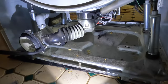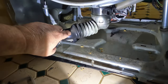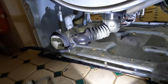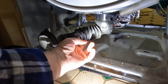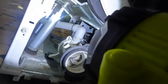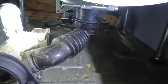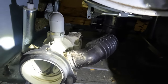They are known to leak on this hose here — if people don't check their pockets, coins and all sorts of stuff can rattle around in here and damage that hose. I found no evidence of that at all. The pump hose, which is just here, looks fine. There's been no water leakage running down that pump there, because it's still got all dust on it.